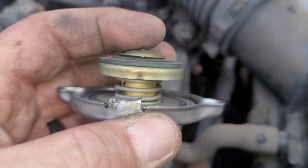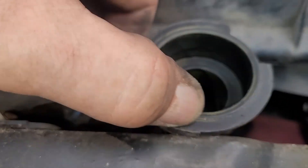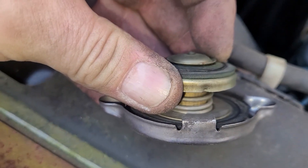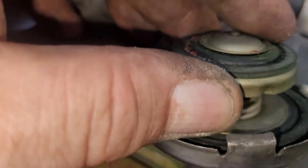What happens is this seal gets compressed a little bit from pressure, so it allows the fluid to go past. The other seal — this one here — seals on the top edge and that's your final seal. That's the one that prevents leaking when pressure is above 18 PSI; it basically acts as a blow-off valve. When the system cools down, pressure drops and eventually goes into a vacuum because you've pushed fluid out. At that point, this small one-way valve piece lifts up slightly, and the chamber allows fluid to suck back through that opening and in between the spring — returning coolant to the radiator.